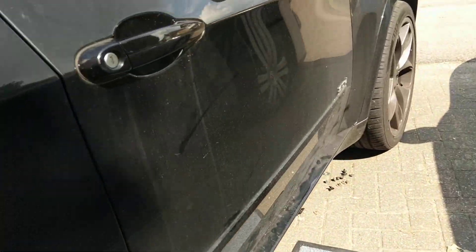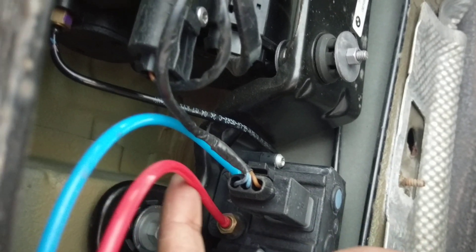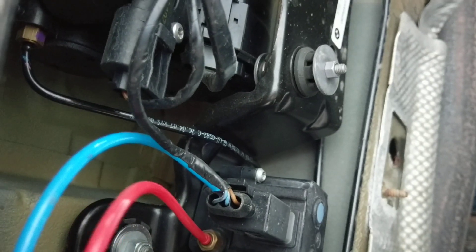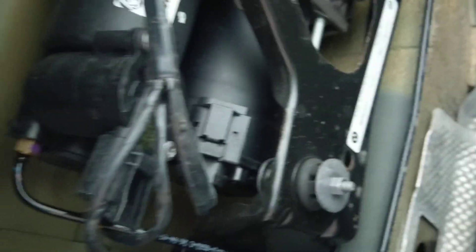This is the driver's side — there's a problem here. Taking the panel off — you can see here's the air compressor right here. And here is a solenoid. Each color goes to one side: this one goes to the driver's side, this one goes to the passenger side. So if there's a leak in one of these tubes, you'll lose air in the suspension. Here's the air compressor — it's actually quite expensive to replace — but it seems to be working okay. The problem is if it keeps having to kick in to refill the suspension bags, it's going to wear out quickly.